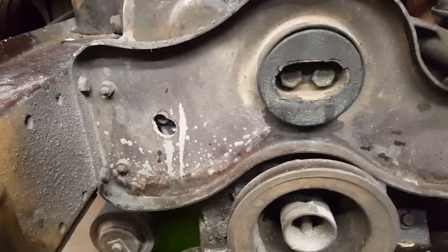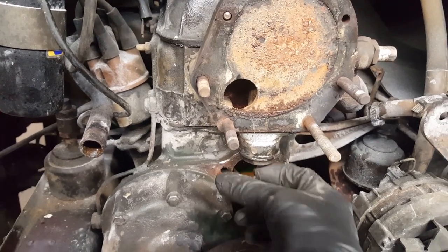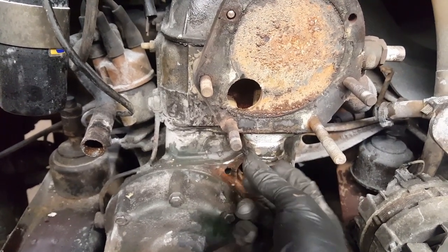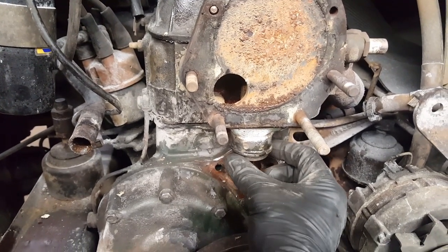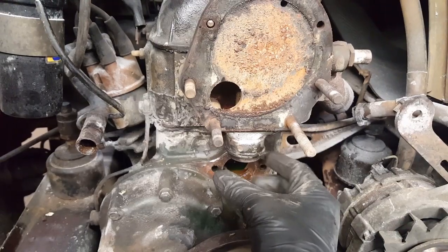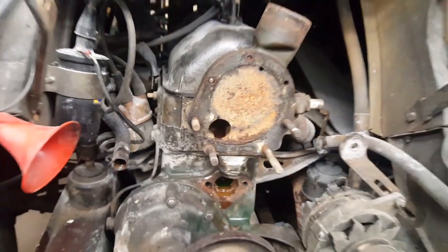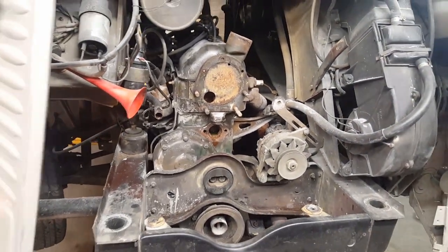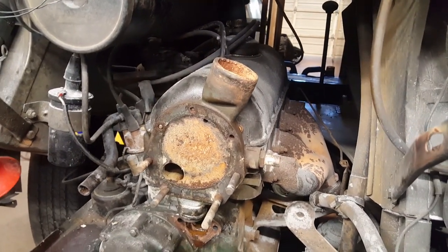Crazy thing. It had been leaking out the weep hole and down here, and we thought that there's like a rubber gasket that goes between the water neck and the base of the water pump housing was leaking, but actually it was the water pump seal, so we got a new water pump. Kind of hard to get it off. We had to use a torch to heat up the bolts, but this is what the engine compartment of a 78 H van looks like.